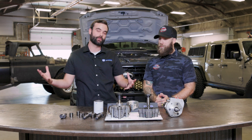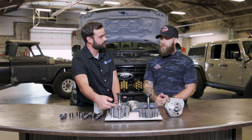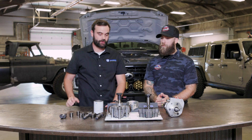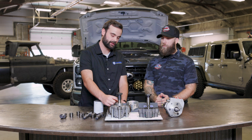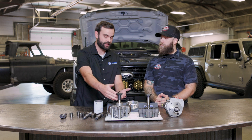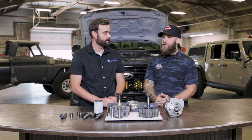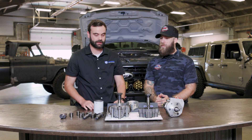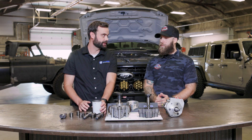With the DPK, what we're doing is feeding the top end of the pump — your IMV — and the bottom end of the pump independently with clean filtered fuel straight from your stage 2 filter there in the engine bay. The key is that bypass block. What that bypass block does is it raises up your metering unit — you set that block in the pump and the metering unit sits in that block. If your pump is to fail, we're just keeping all the case fuel contained in the case, where the debris is made, so you're not ruining your entire fuel system. It then reroutes all that case fuel back to the return side filter that sits in the firewall.